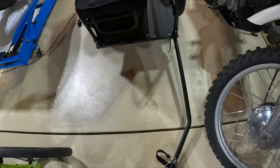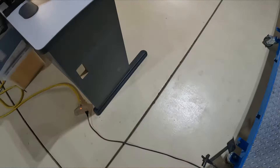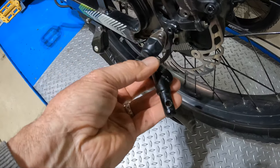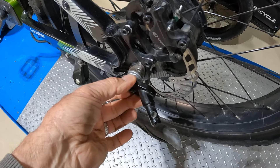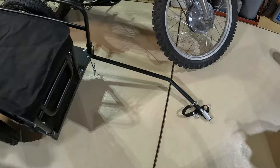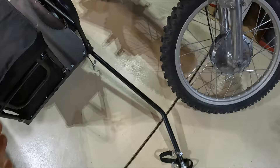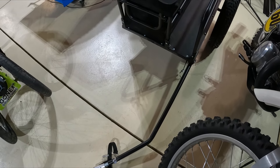We're back to the low tow bar, which hooks to your rear axle. It doesn't have the adapter on it right now — I've got that over here on my desk. These adapters just bolt onto your rear axle: you pull off your cap, remove the nut, put this underneath, and put that nut back on, then the trailer hooks onto that. Nice low center of gravity, but again, if you're taking a sharp right turn, your wheel will hit this pull bar. If you're going the other way, you're good. These are things to think about when deciding what sort of pull bar you want for your trailer.